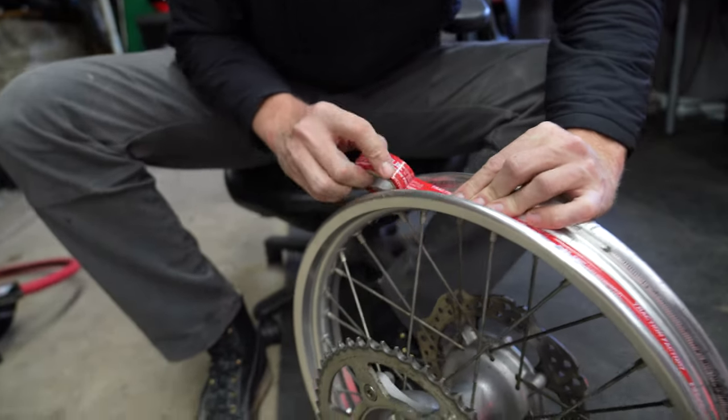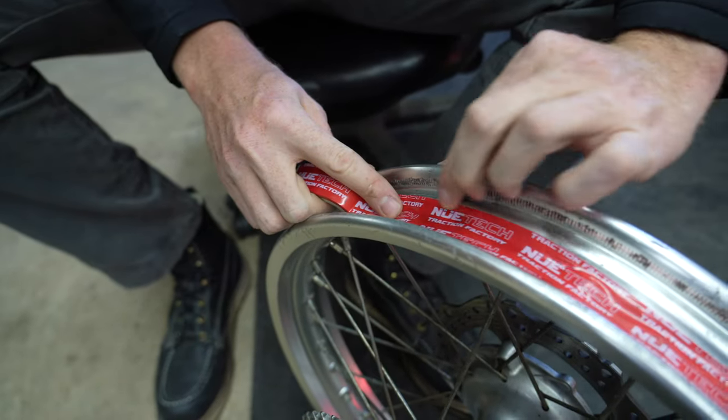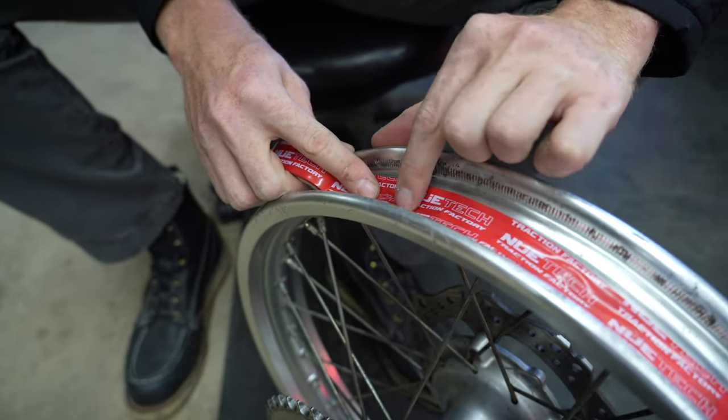You're going to ride up on the shoulder just a little bit — you don't want it in the flat spot, just on the shoulder. You can see the difference in the two materials — about a quarter inch of a difference. That's three full wraps covering both shoulders, with a little bit of excess. Some people have used duct tape or gorilla tape, but it's nice that they include this. I had zero issues getting it to stick to the old nasty rim — just make sure it's clean and free of chemicals.